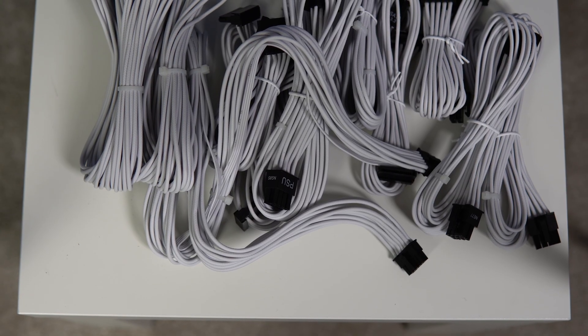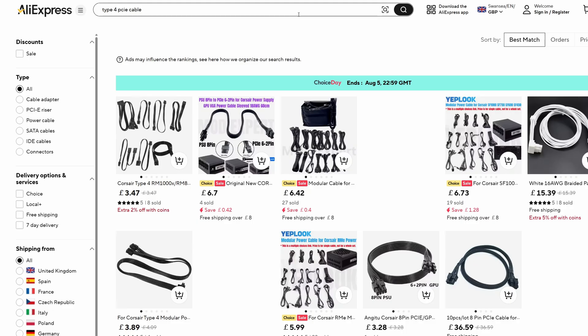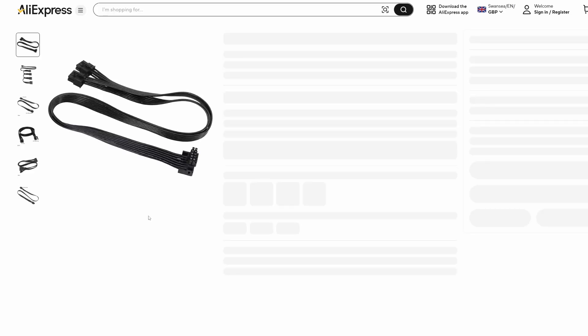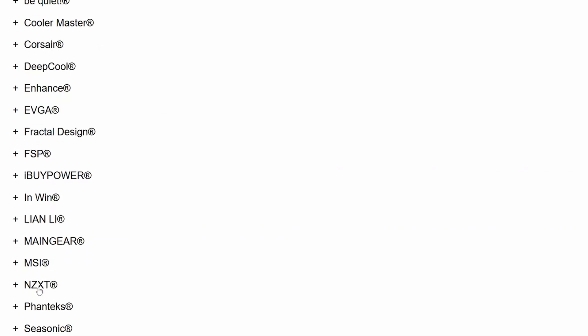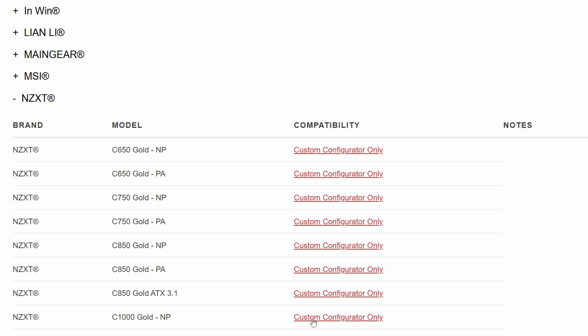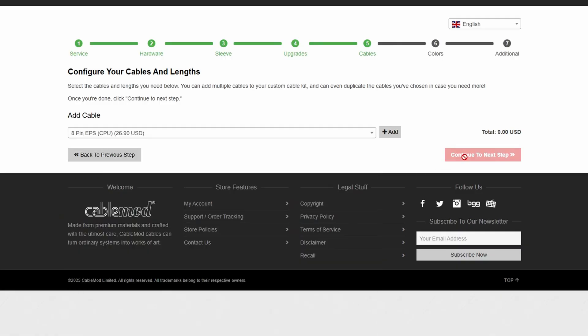But if you've lost your PSU cables altogether and that's why you clicked on this video — wondering if you can use your PCI Express cables for the CPU — don't do that. What you should do instead is buy replacement cables. In general, you shouldn't go on AliExpress and buy random cables from a random seller, and equally if you've got an NZXT PSU you shouldn't buy Corsair cables and mix them — you shouldn't mix and match. What you can do instead is go on the NZXT website, as they often sell replacement PSU cables. If that's not an option for your particular PSU, you can go with CableMod, who are fairly reputable and sell loads of different cables, so you can buy a replacement CPU cable or PCI Express cable and make sure you use the correct one.